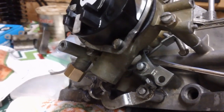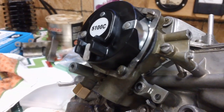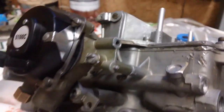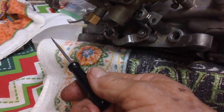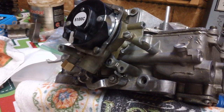Wouldn't you know it — the old automatic choke housing is in the way. I've been calling this 'the choke,' but actually it's an automatic choke. What is an automatic choke? It automatically moves your butterfly for you with the coil winding one way and unwinding the other. Before the automatic choke came along, it was done with a long cable that went back to a lever underneath the dash that operated the butterfly manually. Then they came out with the automatic choke — a really cool system. The whole thing is going to have to come back off again — bummer.